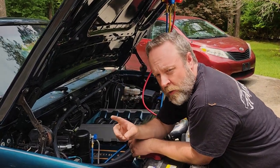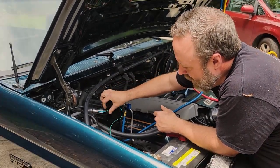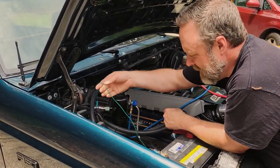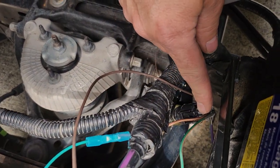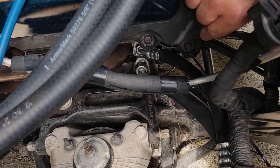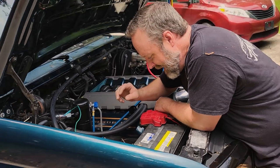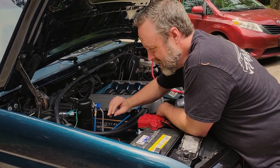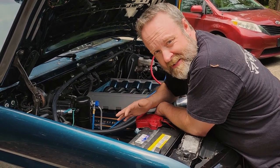The way this originally worked, the power comes from the button inside the cab, right here. And it normally goes right into a pressure switch on this accumulator. Well, we've removed that. So we've extended the wire to come down right into our new pressure switch. And then from there, it goes down to the clutch on our compressor. And out the other side coming back up is the ground. It's that simple. So the idea is, as long as there's pressure on the high side, and as long as there's power telling it to activate the system, it will turn the clutch on. That's all there is.